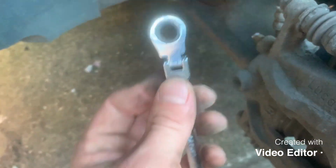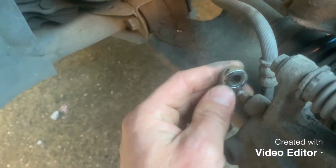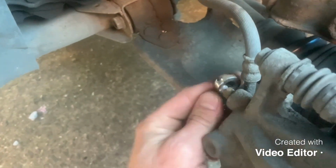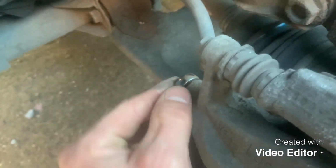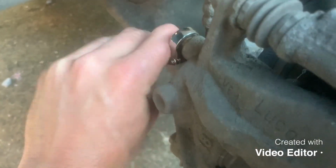So pull the rubber cap off, and then before you put the pipe on, you want an 8mm spanner, preferably a ratchet ring spanner. These are so useful, but any 8mm spanner will do. You get that on, ready to undo, and see that's not left enough space to put the pipe on now. So I'm gonna have to use the thin end and not my ratchet.